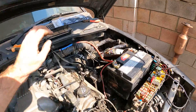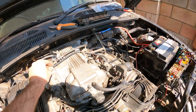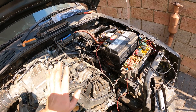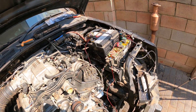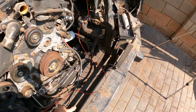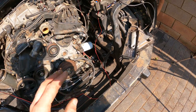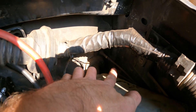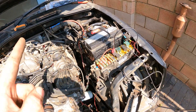Now that I've got my fuel lines hooked up — fuel return is on, main line is on — I've also hooked up my evap system from the Jeep's evap and a vacuum line. All that's left is to clean up this wiring. This wiring is to bypass the standard immobilizer, so I'm going to have to run it through that little hole right there.